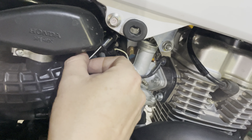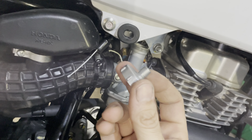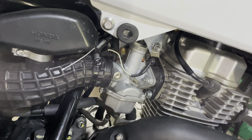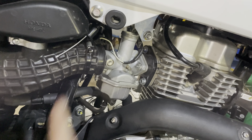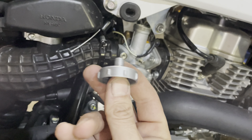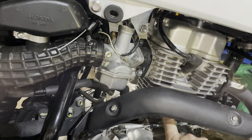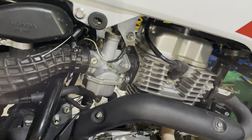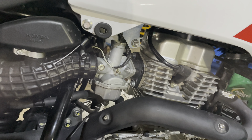This is an aftermarket throttle cable because the factory top hat was mated to the factory throttle cable, which made it difficult to do carb swaps. I put an aftermarket throttle cable in on a previous carb swap. After I put the big bore kit in, it used to be a 150cc with a 57mm diameter piston and now it's a 70mm diameter, 222cc.